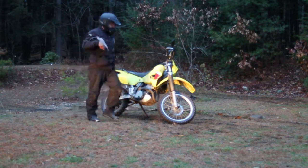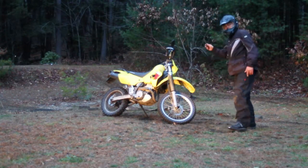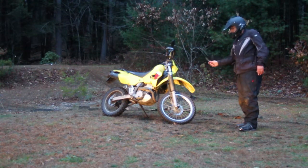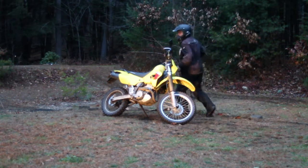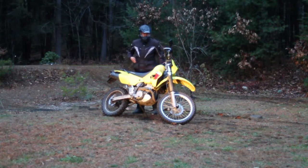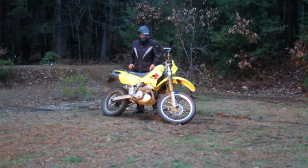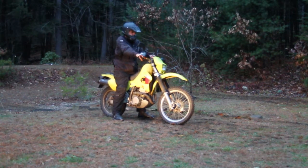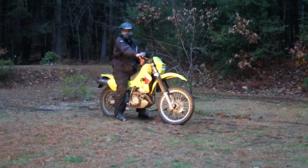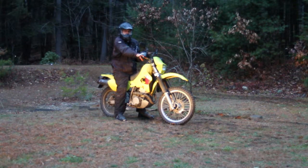Last possible combo to test is no spring preload on the lightest, compression adjustment full on, hard, all the way up, 14 clicks. Now this is starting to feel really good as I'm going up on the compression with the light preload. However, it may not be the best. Playing back this video, especially in slow motion, is going to help me to understand how close I am to bottoming out and therefore how stable that front end is. It may be that this feels really good to me with very low spring preload. However, it's not the best thing for the trail.